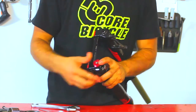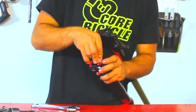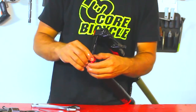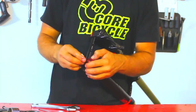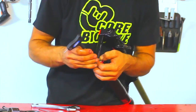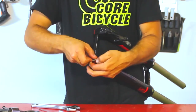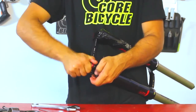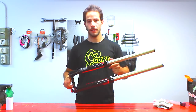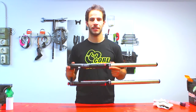Install the red one, the small black plastic washer, and the small rebound regulator at the bottom. Now check that both regulators turn freely and correctly. Now you know how to service your RockShox Boxer World Cup fork and make it work really smoothly. Hope it helps and see you in the next video.